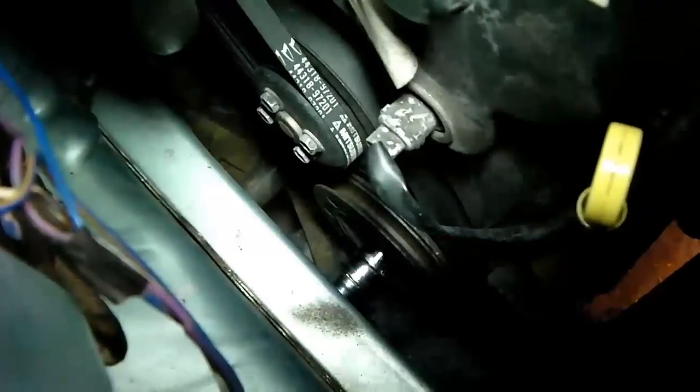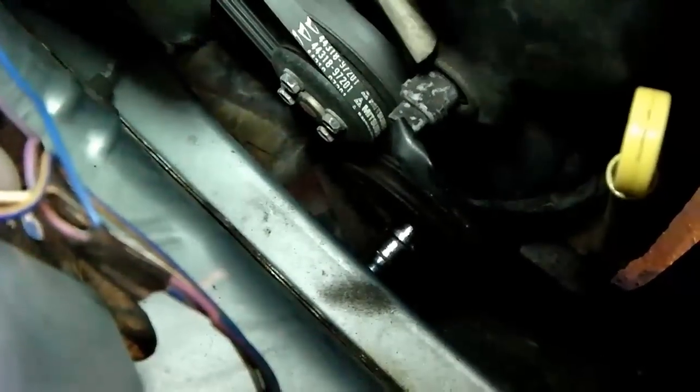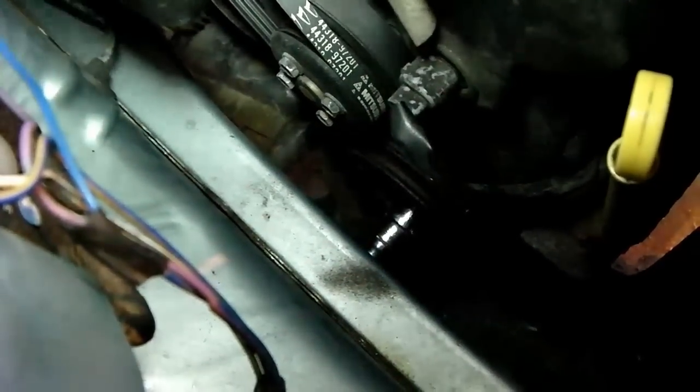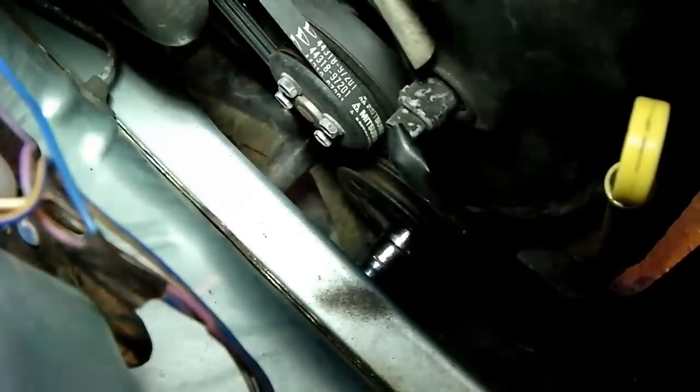Okay, we're just back briefly for a couple of points down in the depths of the engine bay. Apologies for the poor light in here, I'm kind of doing the best I can with what I have. But you'll see down there the main crankshaft pulley bolts. This one up above it with the 4 bolts, this pulley comes off relatively easily because these are low torque. So a good fitting socket, and in this case a 1/4-inch wrench and a good sharp jerk anti-clockwise, and that's loosened those bolts off no problem.